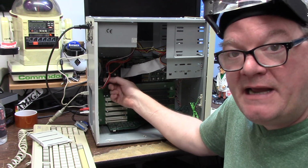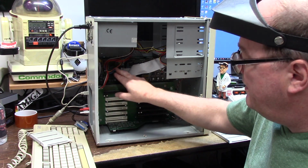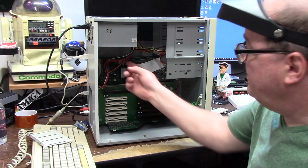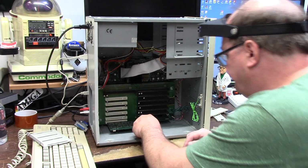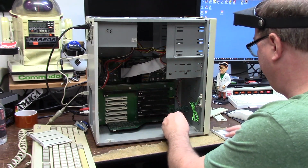You have a P9 cable from an AT power supply that powers the arbitration bus board and normal Amiga 4000 connector. This is an AT power supply, like I've said before. You can also repin it because it's only the standard cables of an AT, minus the addition of one 12-volt. It also gives you standard Berg, standard floppies.